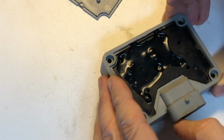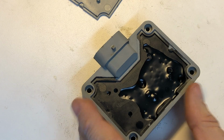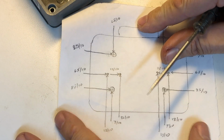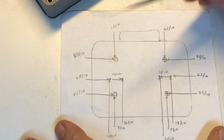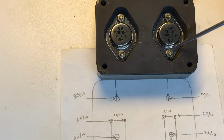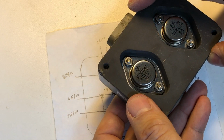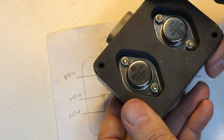The next thing we're going to do now is begin to locate where the things that we have to remove the conformal coating from are. And what I like to do from past experience, I've got my little cheat sheet here. I know the location of the 2 Phillips screws that are used to hold this into position. On the other side, the studs that have the nuts, right? So these 2 screws here would correspond to what we see here with these nuts in these positions here, here, and here. There's 2 pins that come out of this particular old 1970s style transistor. This is an MJ15004. The modern versions have a G suffix, but the original ones from Motorola in the early 1970s did not.